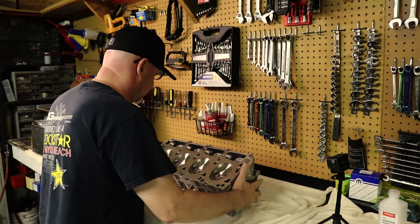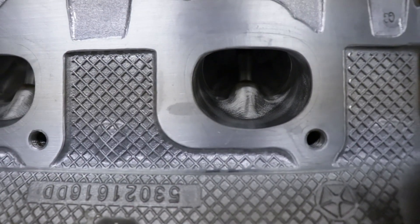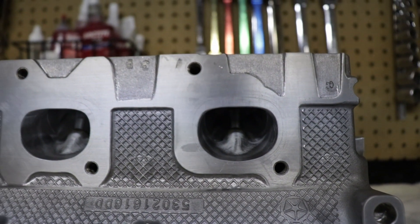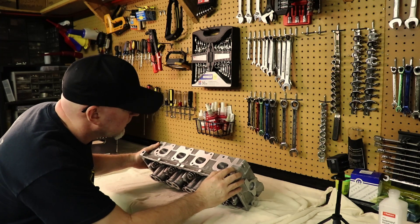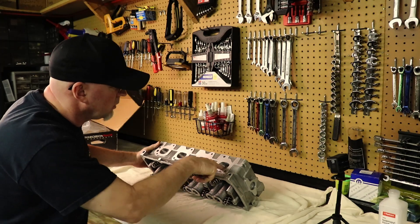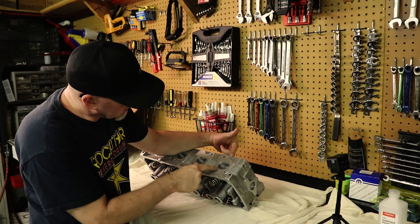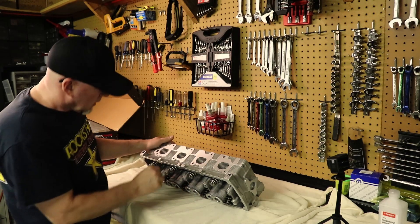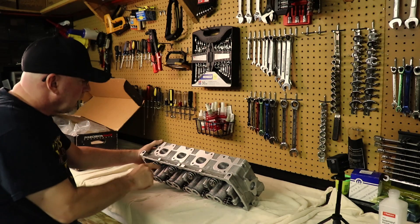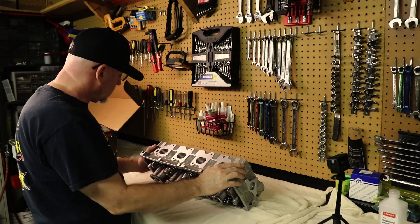Let's look at the exhaust ports. That's pretty good, but there's a little ridge right there too on each one. Granted the exhaust flow is coming out this way so it's not hitting a wall or a ridge, it's just kind of going over it. But that's where hand blending could have been done. I do see a little bit of hand blending down in there on the valve side, but on the port side - that's where they say it's most important because that's exhaust. They went in there and cleaned it up just a little bit, about an inch below the bowl below the seat. That looks like hand blending there, but that's it.